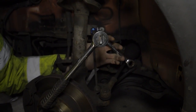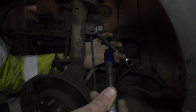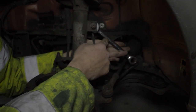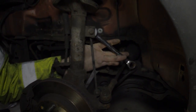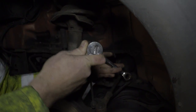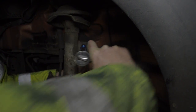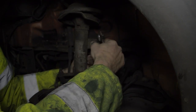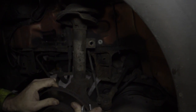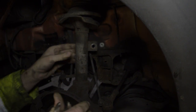Using your 17mm spanner, put it on the lock nut behind the suspension mount or the anti-roll bar mount, and then use your 15mm socket and undo it. To get it out you may need to turn the steering slightly to release it, but Mark was luckily able to do that without it.